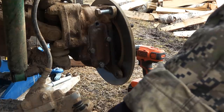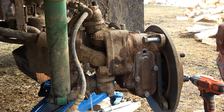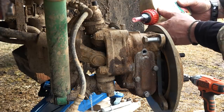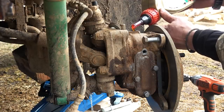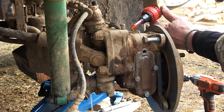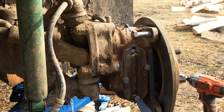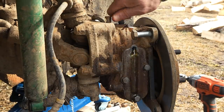That's the level plug, so let's see how it goes — let's fill it up and see how much it's going to take. Normally it takes 600 milliliters, but since I have installed some aftermarket sprockets inside, the gearing is a little bit higher, so we have less speed but more torque. So the volume of the portal hub is a little bit less than original. The hub is now full of clean, nice new oil — Russian oil, actually.